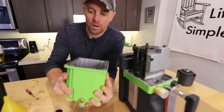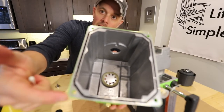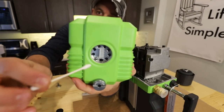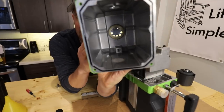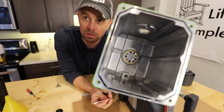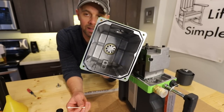While we have the cover off, you'll notice there is a rubber seal that goes all the way around it. Make sure you don't take this out, and if it does fall out, put it back in. Either way, coat it with oil before putting the cover back on. There's also a sight glass in here — if it has some crud running through it, a lot of people don't know how to clean it out. The best way is to take a Q-tip and get inside those little holes to wipe it out. You can also try rubbing alcohol or some of the brake cleaner. The little guard with holes in it doesn't come off easily, and I'm not willing to risk it not going back on.